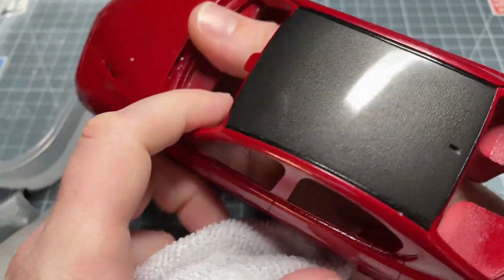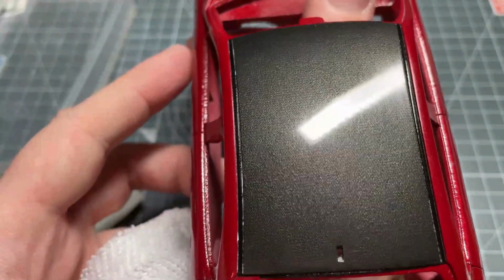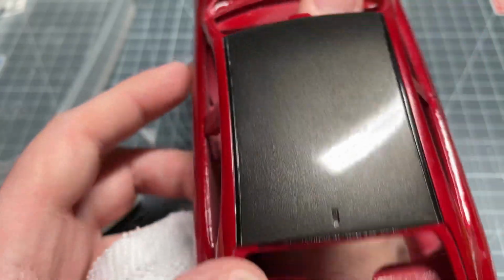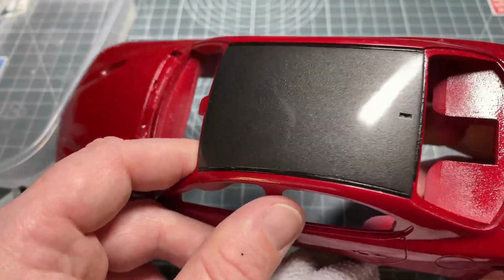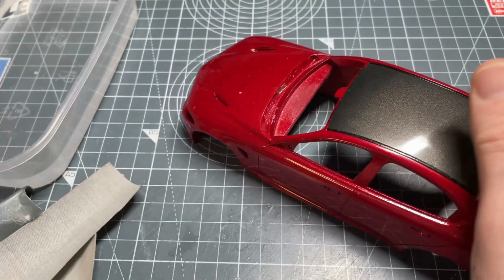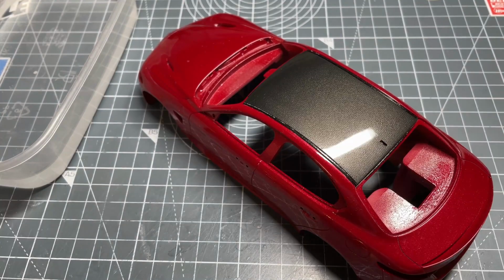So you can see now that the shine's starting to come back, and a lot of that orange peel and lines and stuff from the sanding process is now disappearing. You can see from the reflection from my light that it's got some detail in it, and other reflections there that you can see. So if you were to machine polish, you get this process done quicker, but by hand it just takes a little bit extra work, a little extra effort.